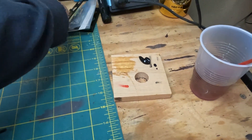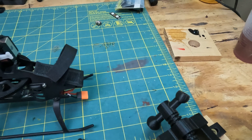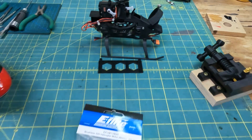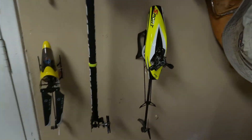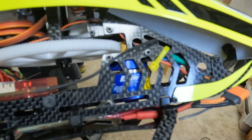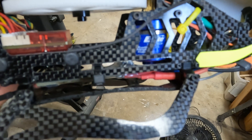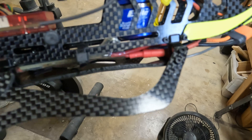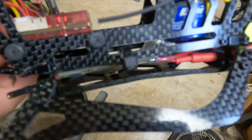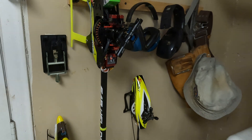I 3D printed a bracket that's going to go between the skid and the frame to hold the ESC. I can show you how I did it on this three-bladed upgrade here — again with the large motor. You can see down here I made an extra little shelf for the ESC. It's not necessary — you can squish it in up top if you need to — but I found it a lot easier to access, and it's going to get a little more cooling with the motor out of the way.